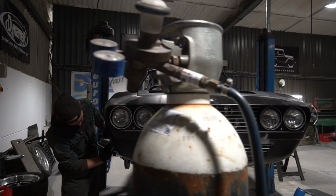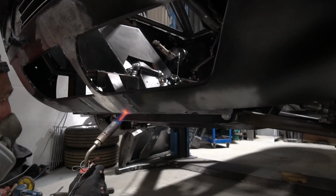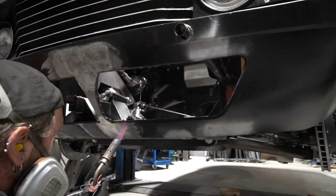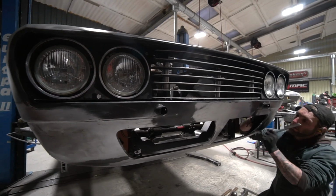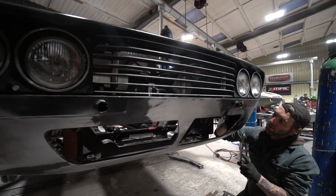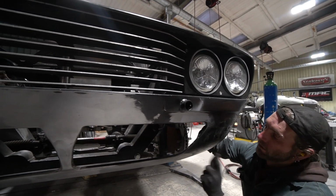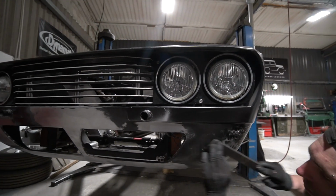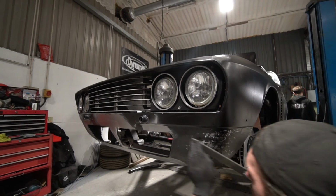There was also a bit of a dog leg kick in the wheel arch, both sides, where the wing was joined to the valance. So he's pulled that out, hammer and dollied it out as much as possible, and then he's tidying up the outside face with lead, filing and a little bit of panel beating to get all that right. Then he's going to cut the lead in around the wheel arch and tidy that lot up. Then we've got to wait for the bonnet skin before we can do the lead work around the bonnet aperture. That's where we're at on the front end.